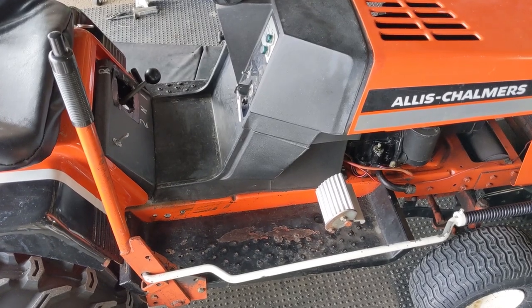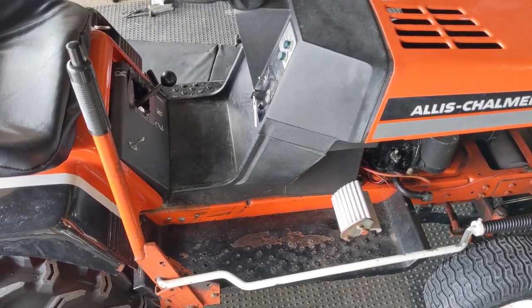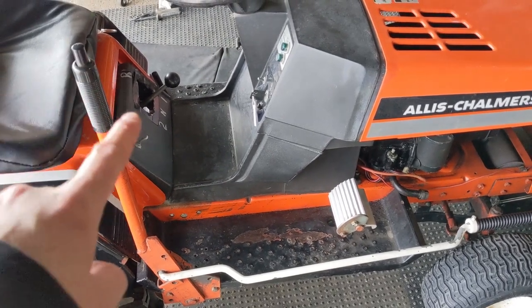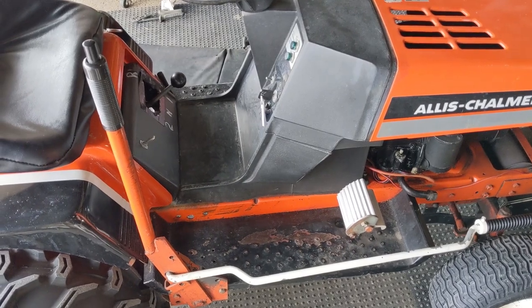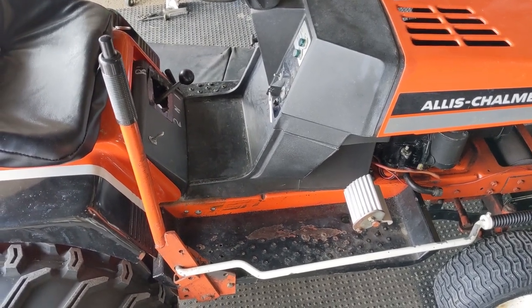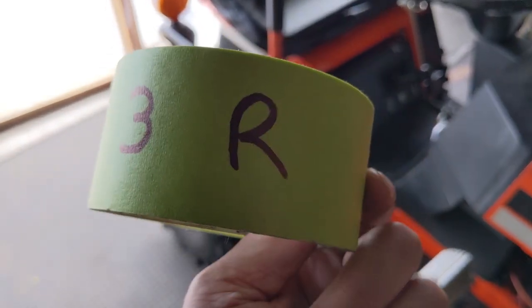And this system is not a variable drive, compared to like an MTD lawnmower with a continuously variable transmission. This one has three fixed gears and a reverse gear. And if you want to drive in any of those gears, the belt must have full tension on it to prevent slipping. So I got a roll of painter's tape here that I marked 1, 2, 3 and R,